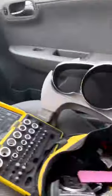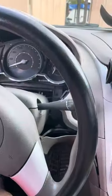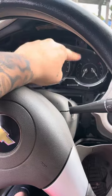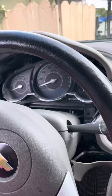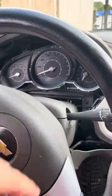After that, these pieces right here — I took this out; it's nothing but clips. I just pulled it out and it came out pretty easily. Once that was out, there are four screws — one, two, three, four. You take those four screws out, pull the cluster out, and behind it is just a little tab, a little connector that you pull out.